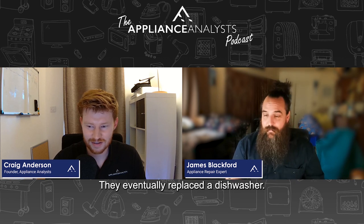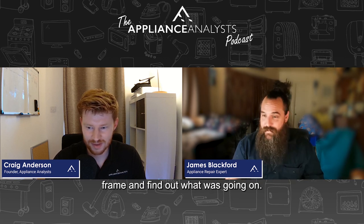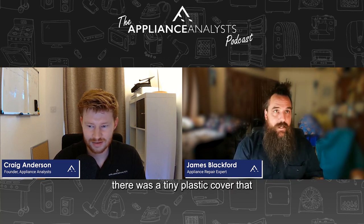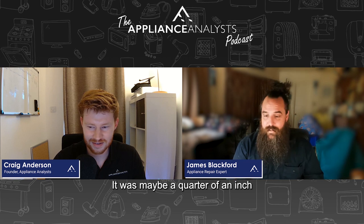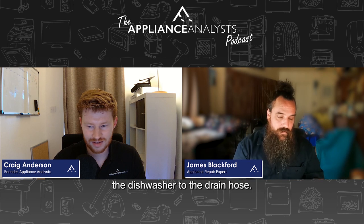They eventually replaced the dishwasher. I requested to have that dishwasher so I could completely gut it down to the frame and find out what was going on. The whole time, the only problem with it, and it was literally costing her the ability to use it, was a tiny plastic cover. It was maybe a quarter of an inch thick, maybe 2 inches long, but it sat over where the water drained from the dishwasher to the drain hose.